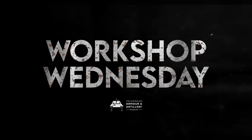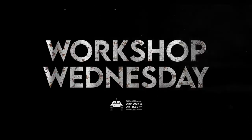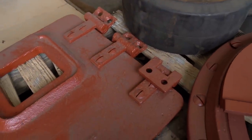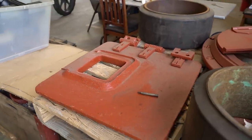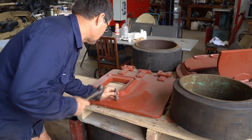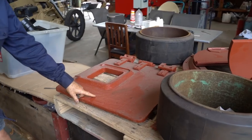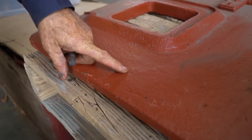This week Daryl started working on the hatches but things don't seem to be lining up. Unfortunately with our Grant restoration we've only got two right-hand doors, so what we're going to do is take this spare door and move the hinges over to the other side. If the punch leaves a dent in the steel we should be able to drill it nicely.